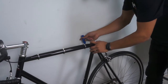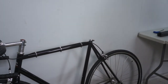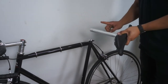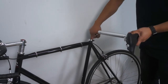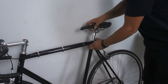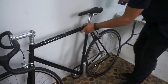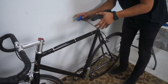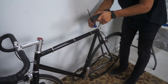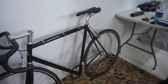Re-center the brake quick release. Before installing the saddle, use your 5mm wrench to loosen the seat binder bolt — remember to always loosen it on the drive side. Next, grease the seat post and grease the interior of the seat tube, as this is important to prevent seizing later. Now, insert the seat post into the seat tube. Determine the right height for the saddle, make sure it's even with the top tube of the bike, then use your 5mm wrench to tighten the seat binder bolt down to a torque of 5 Nm.